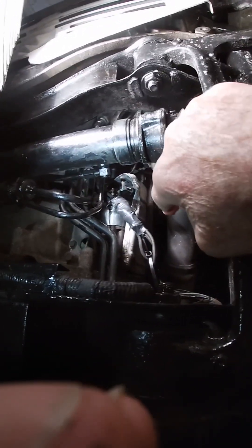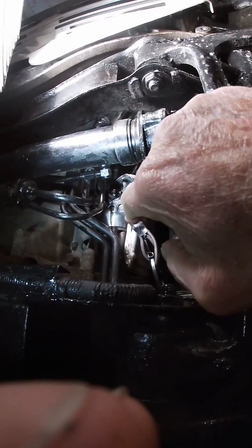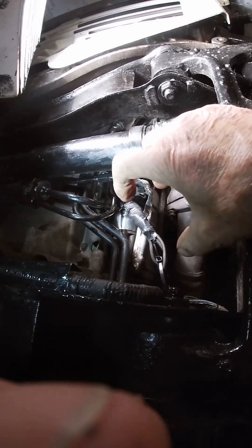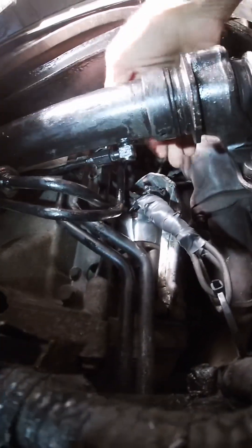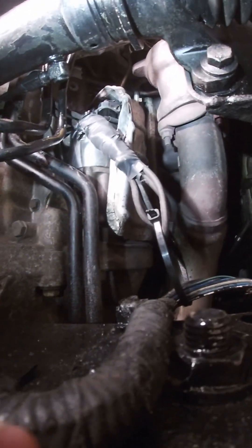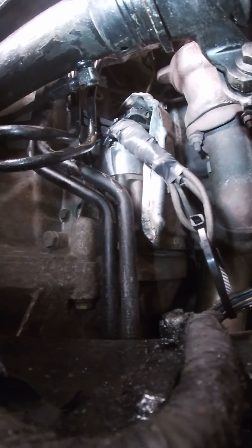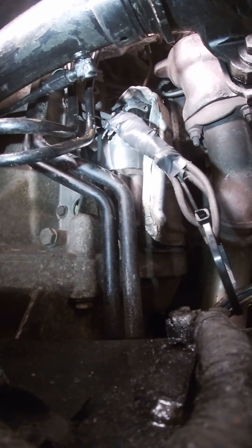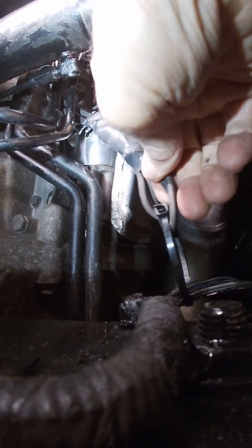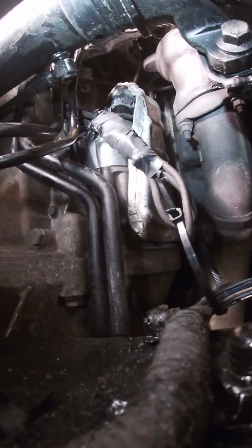That's your gap. Just remember to take the starter out drive-end first, so the drive end comes out through here, and you push it back in the same way. Once you've got it in, you can fiddle it around in this gap and that will do the job. You don't actually need to remove anything at all. I've extended the cabling, but you don't have to if you want to fight with very short connections — one of the starters came with these special heatproof cables and I decided to keep them.